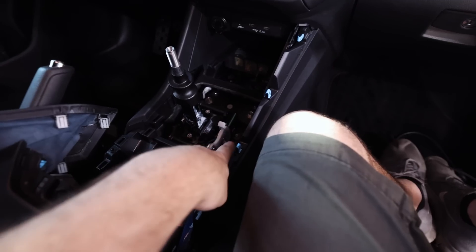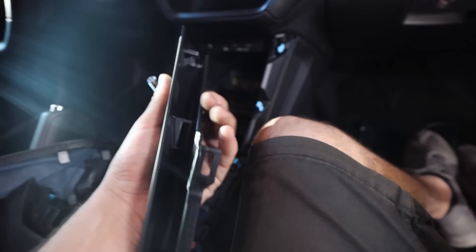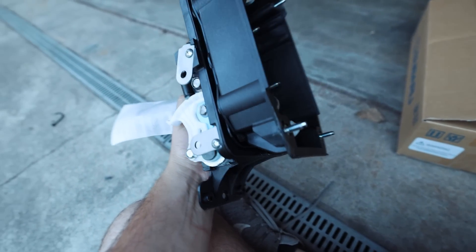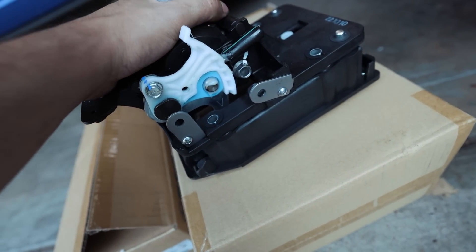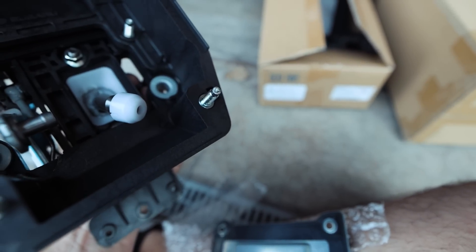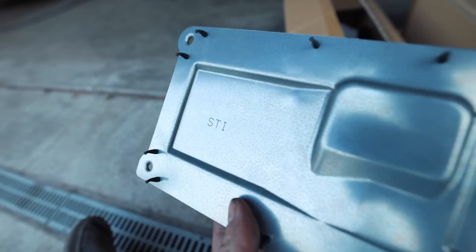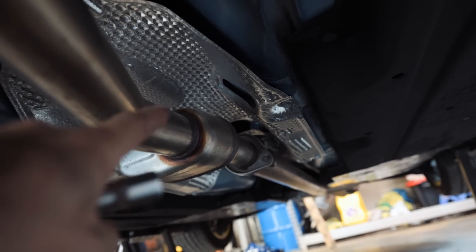The top part just pops right off. These little trim pieces - there's one screw on the inside and then the rest are all just clips, so they literally just pull right out, making them easy to swap for the alcantara ones. Behind the heat shield that runs above the J-pipe is the shifter bezel with the bolts. Behind the steel plate you've got two cables - one is like a cup that sits inside the shifter assembly, the other is an actual cable assembly.